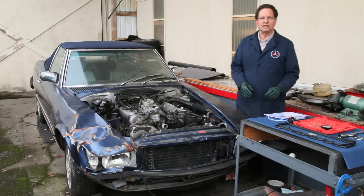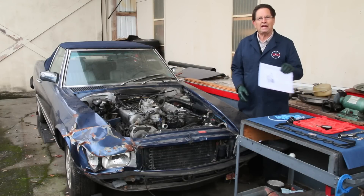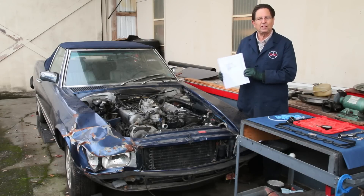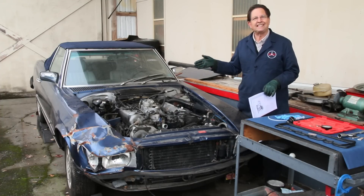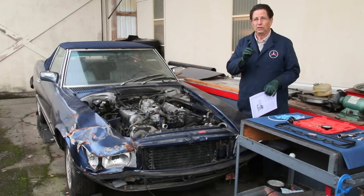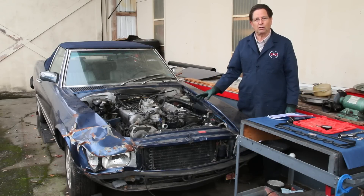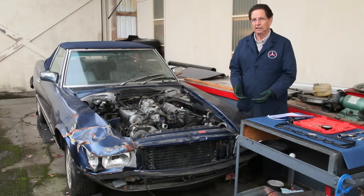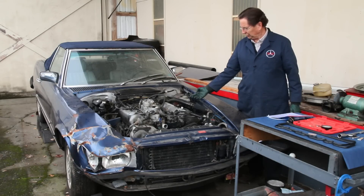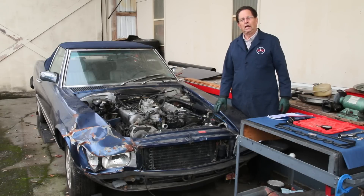If you're interested in this early V8 physical exam kit, check it out on my website. If you find problems when you take the valve covers off, I have a manual on preventing catastrophic V8 engine failure. It covers how to change the oiler tubes, check the timing chain, and check the timing chain guides — because if you lose a timing chain in these engines, you destroy the engine. You cannot believe how many of these I've run across where the timing chain flew off the sprockets, either because the chain was worn out or a guide broke and got jammed in the sprocket. When that happens, the pistons come up and hit the valves. I've even seen one where the camshaft was driven right into the valve cover.